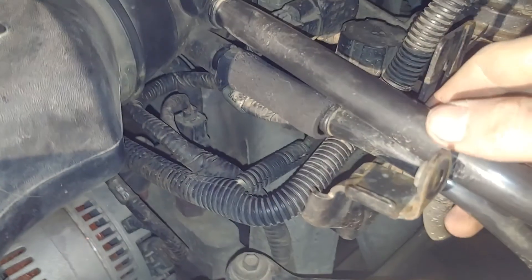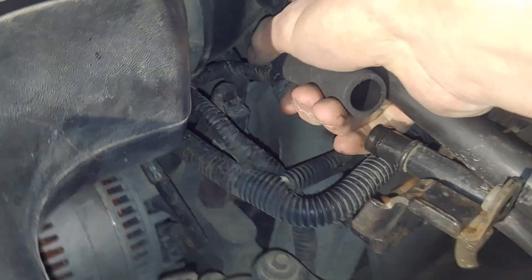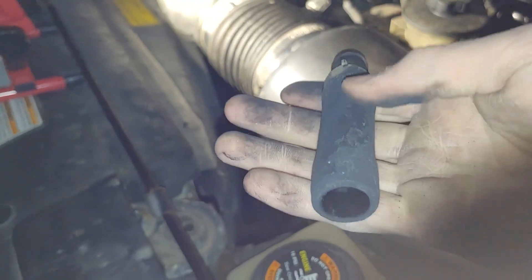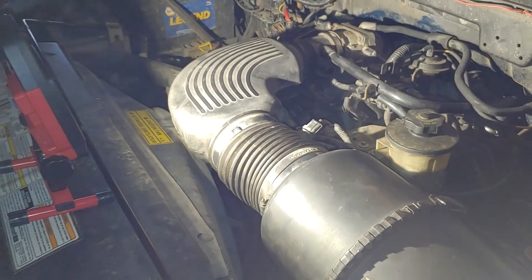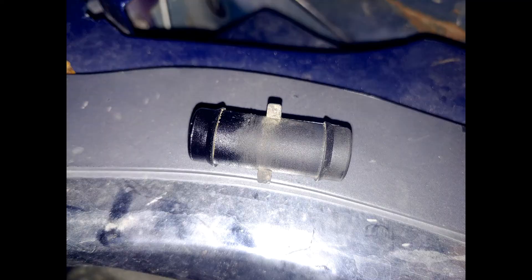This one here has quite a gap and it's pretty loose where the end is, so I'm not keeping it like that. The auto parts store didn't have the actual part itself, but they had hose by the foot so I cut off a little chunk to replace it with. This replacement hose doesn't have fabric fibers inside but it's a little thicker — the inside diameter is what matters. You can touch the old one and it just disintegrates into black powder, so I take the plastic end off with pliers and throw the new hose in.